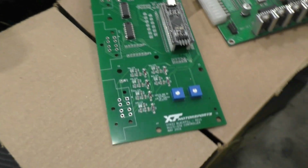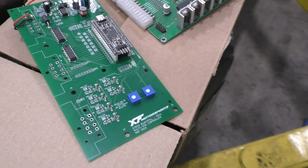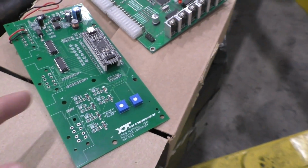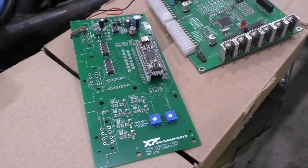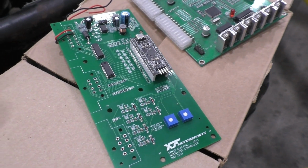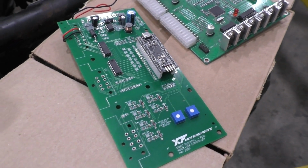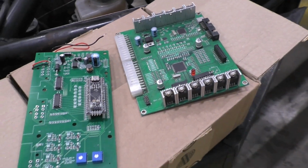All this does is take any inputs from the paddle shifters and use a voltage divider and an RC filter to bring that signal into the Black Pill as noise-free as possible, and then we'll use these relay drivers to drive the solenoid valves, and hopefully this system altogether should be much more reliable than what was existing in the car.